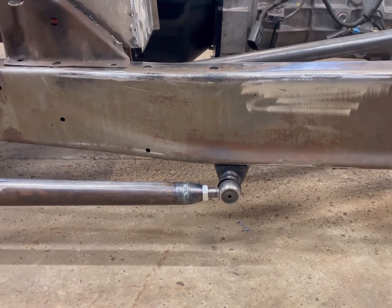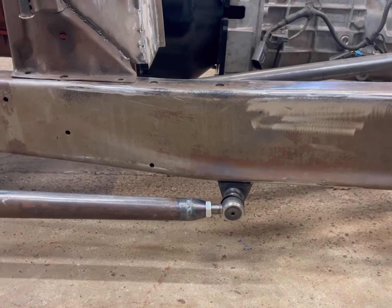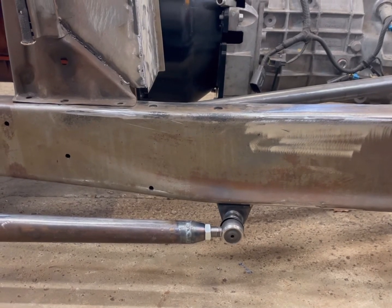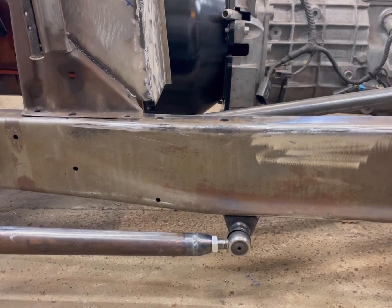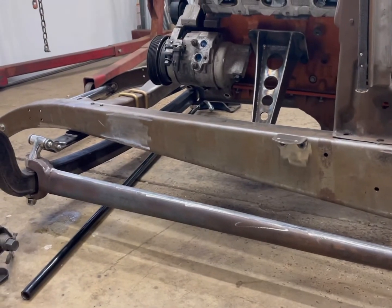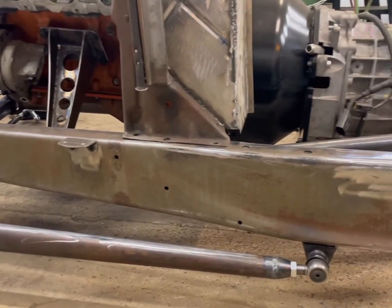There they are - got them on the car, got everything squared up and true, measured it multiple places to make sure it was in the same spot, and went ahead and tacked it on with a MIG. I'll wait until I can put the chassis over or get it up in the air to fully weld those on - I don't want to be welding on my back if I don't have to. Front axle's in the right spot and we're rolling along on this front suspension. I think that's enough for this video. Next we're going to try to figure out the steering arms, which are going to be a bit of a challenge because the axle is so dropped that the steering arm is hitting the bones. Thanks for watching Thrasher's Ghetto Fabricating - we'll see you next time!